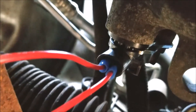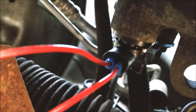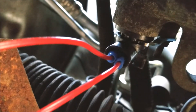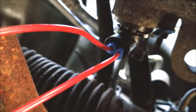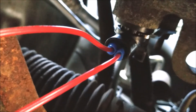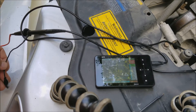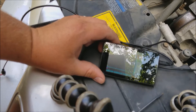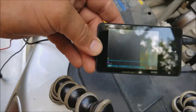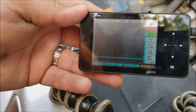I've rigged up two spade clips — had to cut them down a little bit to make sure they're not touching — and I've got insulated ones. This serves two purposes: I can actually be out from under the vehicle when I'm spinning the tire, and it makes it easy to clip up in there. Now we've got the oscilloscope hooked up — here's the negative wire and the positive wire. Right now we're not reading anything, which is good because obviously it's not spinning.